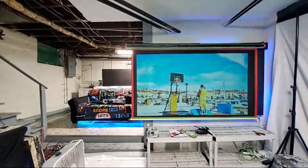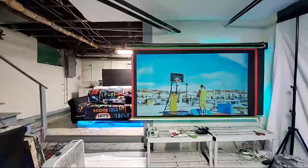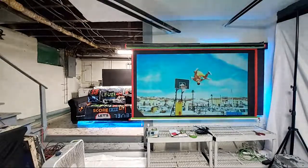I think my personal favorite was when he was explaining Black Diamond's theory about how they print on. Newsflash, buddy, all freaking motorized projection screens have a printed-on border. It's virtually impossible to stick a border on, because now you've got an inch or more of felt sticking out from your screen on either side, and it's going to cause unevenness in the middle of the screen, which means when it rolls up, it's going to buckle inward. They're all printed on. Now, Black Diamond has a better design on how they print theirs on than everybody else, but they're all printed on. Anytime you buy a motorized projection screen, and it says it comes with a 2-inch or even 1-inch velvet border around the screen, you'll never see that, never. So I don't know where you got that theory from,